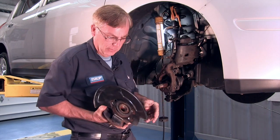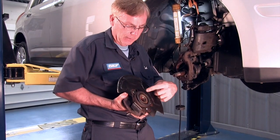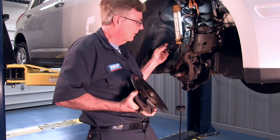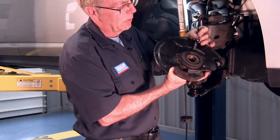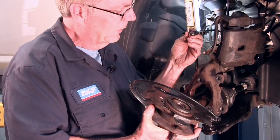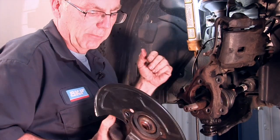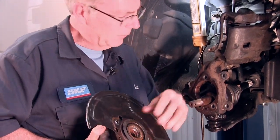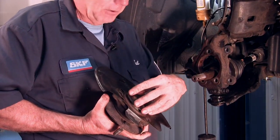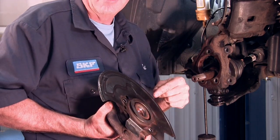This is what I wanted to show you — pay particular attention to this. This style of hub has a protective cover on the back side that protects the magnetic encoder ring. Your wheel speed sensor sits right in between that cover and the magnetic pickup. If you don't remove this before taking the hub off, the tip will break right off each time. The other thing to be careful of is this cover sometimes sticks in the knuckle, so make sure it's removed. Otherwise you're going to put a new cover on top of the old cover, damaging the wheel speed sensor and the new hub unit.